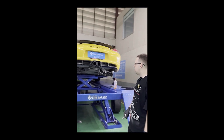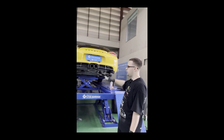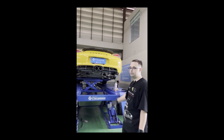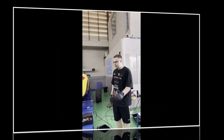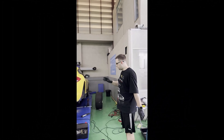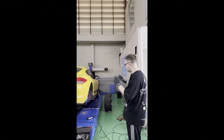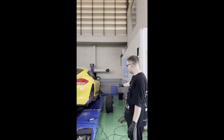I will have the employees remove the exhaust and the plastic casing around the gearbox, and we will proceed with the repair. When removing the exhaust, there is a trick which will make the task much easier, and that is to remove the wheels — you remove both wheels.